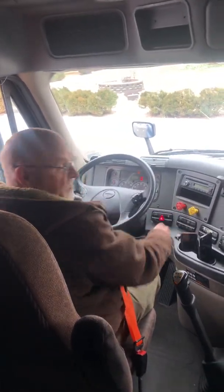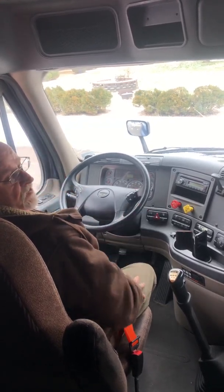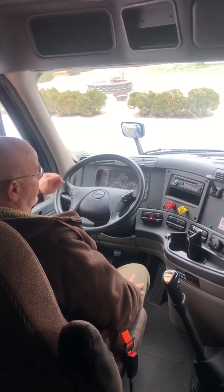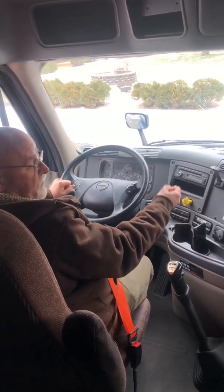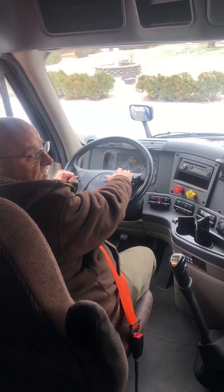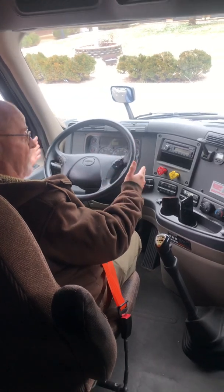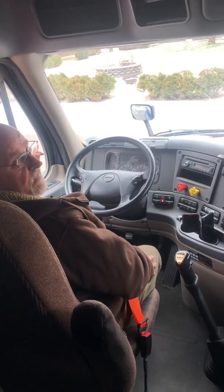Now, if I had stopped before that second button popped, automatic fail. If the key's off, there's no alarm. Automatic fail. If the engine's running, you're building pressure as you're doing this, automatic fail. So, key off, engine off, key on, ABS light, leaks, alarms, buttons. ELAB, or ALAB. ABS, leaks, alarm, button. That's the critical part. The rest of it is part of your 80%. The brake test is by itself. It's pass or fail, no percentage allowed. 100, you either get it all or nothing, okay?